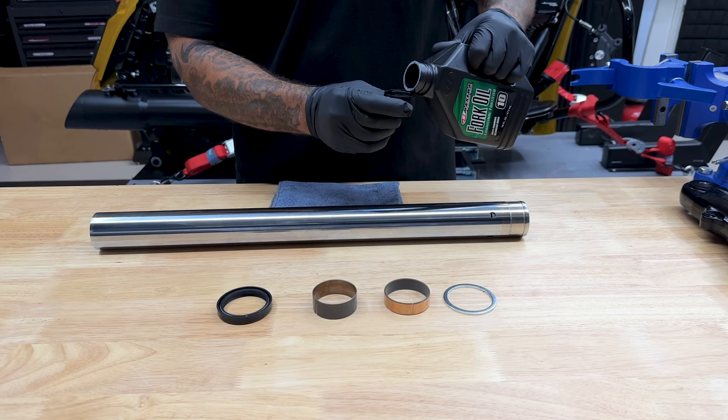Now I'll remount the left brake caliper. If you haven't done so already, make sure you thread chase these holes and also clean off your mounting screws. For your left caliper, you do have this wheel speed sensor guide — make sure you install this the right way. You should see some wear marks from the screws on the mounting bracket that'll tell you which way it was orientated. I'm using a 10 millimeter 12-point socket to tighten these down. The torque value for the front caliper mounting screws is 28 to 38 foot-pounds.